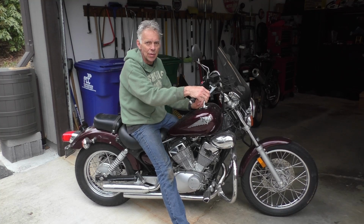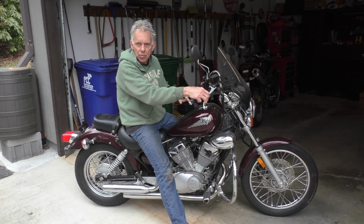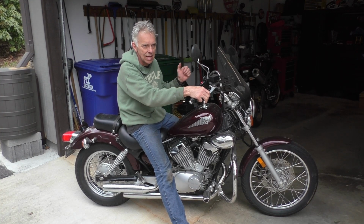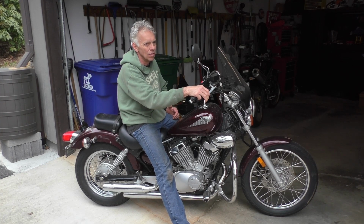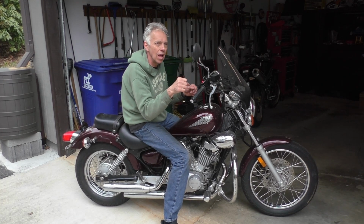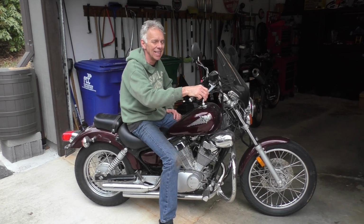The original video I did, there's a link in the description, was some work on the carburetor on this. It would start, this was characteristic of these bikes. Start up when they're cold, they need a lot of choke, they don't like to accelerate worth a damn till they get really, really warmed up. And even then there's a little bit of lag. You roll the throttle on, it's just got this horrible lag.